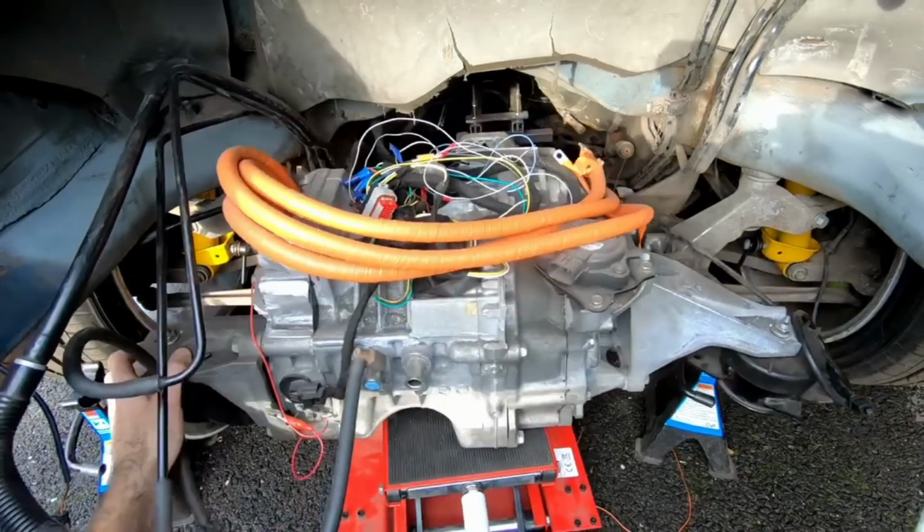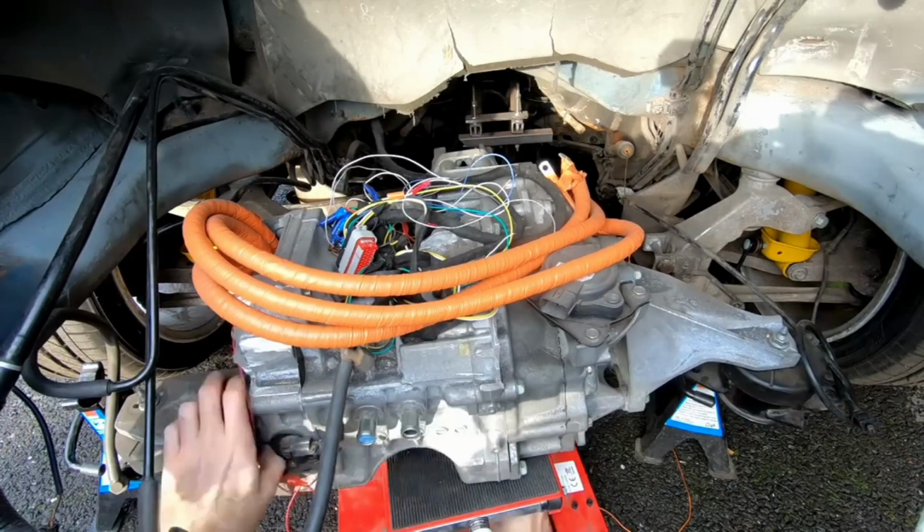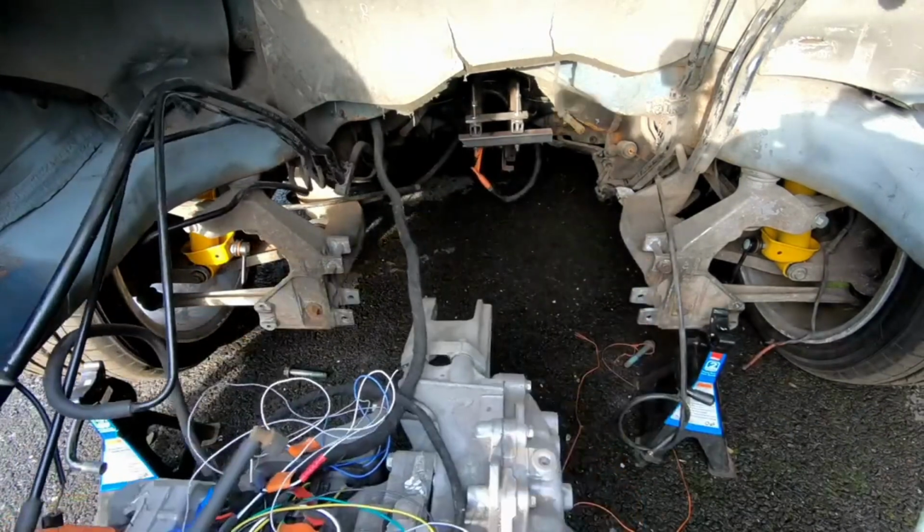So with those back in place, I had a decision to make, because every time I install them, because they are a combination of Porsche and Nissan parts, I have to disassemble the suspension in order to fit them, and I didn't want to have to do that too many times. So I figured now was probably a good time to start doing the permanent jobs on the car. Anything that I'd done temporarily, I was going to remove, get rid of all evidence of it, and then figure out how to do a permanent job. That was things like removing the engine mounts that I'd made. There's just going to be too much flex in them, and I didn't want to risk the motor falling out on the road or anything like that.